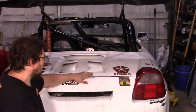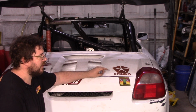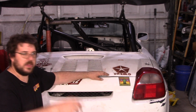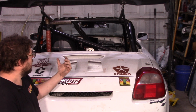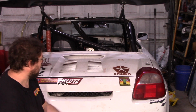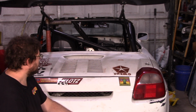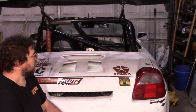So I think I'm finally going to have to give in. I'm going to take the suspension and raise it by, let's say, 3/8 of an inch, 10 millimeters, and we'll see what that does. That'll add quite a bit of angle to the shafts, and since I don't have anything adjusting the roll center, it'll actually improve the roll center also, which will be nice. But it does raise the center of gravity, so it's a toss-up. I think between that and these new axles, I hope to finally have this problem solved.